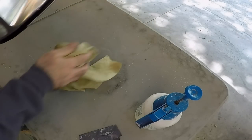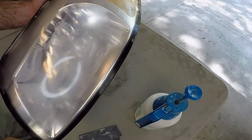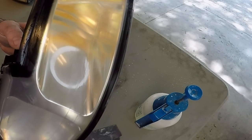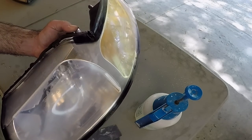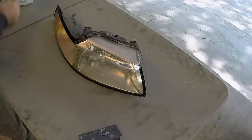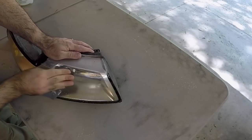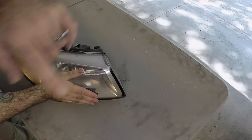We're doing something that most people would do in their garage — you come out one day, you want to sand your stuff and make it look better. This is a really good option. I'm going to spray this with a gun using 2k clear, but you could buy a 2k clear in a can and do the same thing. We're going to set this one to the side and jump over to the next one — same procedure. We'll wet everything down and start with 600 grit. Same process, so I'll fast forward to the finished product.